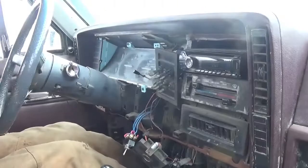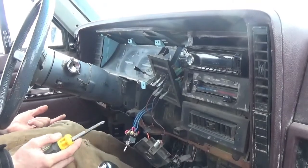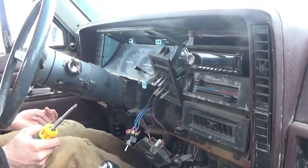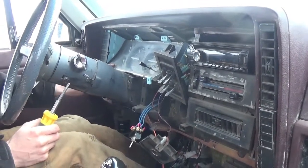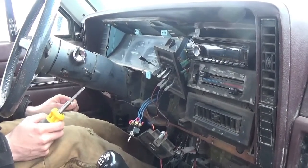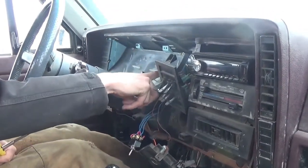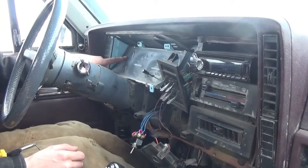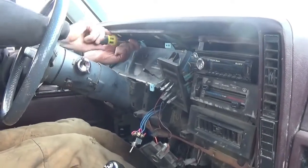Hopefully we can sit inside of it. This is the gauge package — my original one didn't have that. There's not a lot of videos out there on that. You just have to find a gauge cluster that is from the same year. This one is actually also out of a manual Cherokee, so it switches across really nicely. I just had to change out my oil pressure sensor from a switch to a pressure sensor, and I believe my temperature sensor would have been changed too. So we're going to take all this out again and it's going to get changed to all the new stuff.